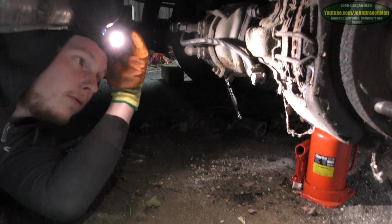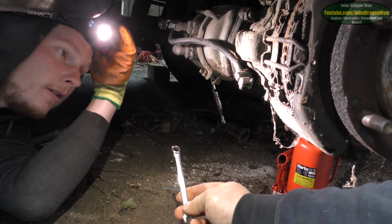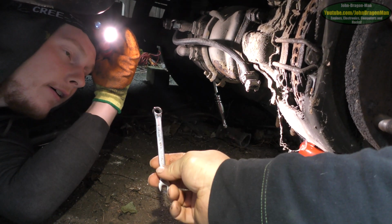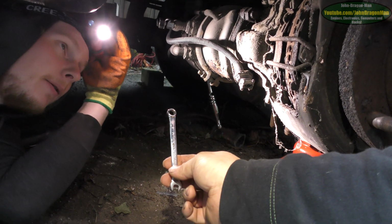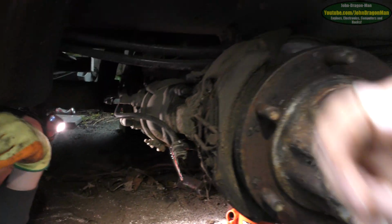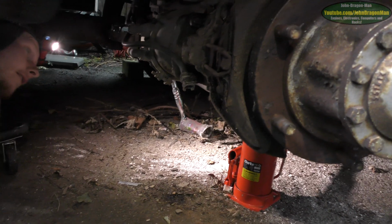Well, now it's free. Maybe you can wind the pads back using the 10mm, the 8mm on the back of the caliper. Maybe. Because we need to wind this gap in here. Yeah. The worst we can do, we could just take the pads out, to be fair. Here you go. Now there's no pressure on the actual brakes at all.